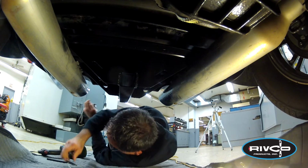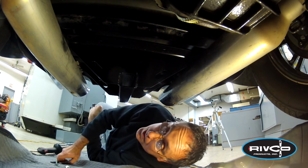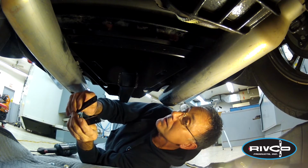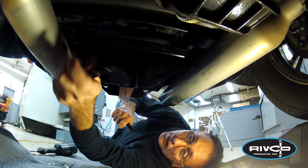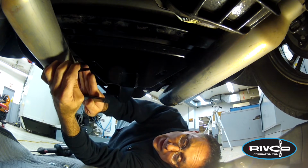The next thing we're going to do is locate our other 2 bolts, lock washers and washers, and then we're going to put our screws or bolts in the forward cross member, and that requires using these 2 nut bars that we have. If you notice, the screw hole is offset to one side. On some years, you'll find that that hole is very close to the edge or the bend here. That's why that's offset, so you get the hole to line up right next to that bend.